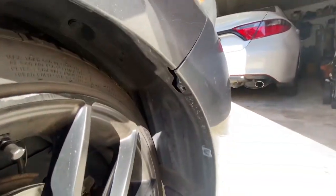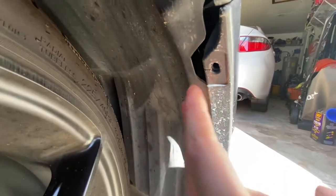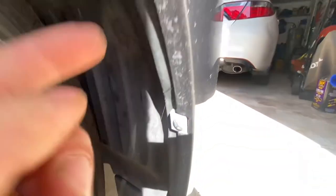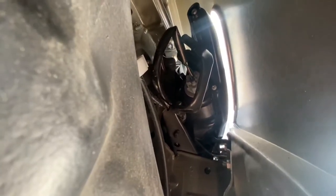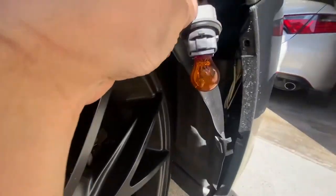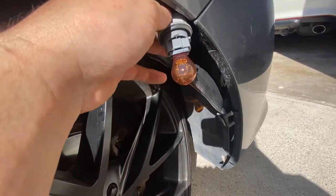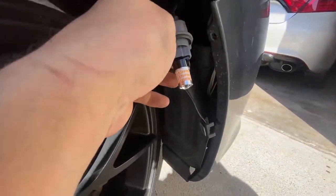To get to the front turn signal, it's way easier to go from the fender liner. There's one clip right here, and on my car there should be another clip but it's missing. You'll pretty much just screw this and pop it off, then pop the other clip and pull back the fender liner to see where the bulb is. Up there, the gray connector — you'll unscrew that, unplug it, and put the new LED one in. Just reach your hand up in there; there's plenty of wire so you can come out of the fender well and change it.